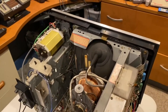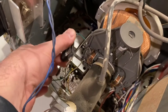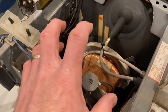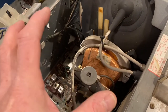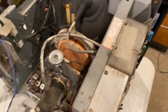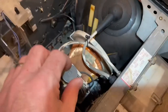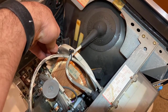All right, so I've got the TV apart again, hopefully for the last time. There's a knob here that you can loosen, which will let me turn the yoke back and forth and forward and backward to adjust the tilt and maybe some of the convergence and geometry issues. I'll need to turn the TV back on and then move it — I'm going to wear gloves and be careful. I was able to break it loose, and the yoke can now twist back and forth, so I'll set the camera up on the front side and we'll see what effect that has.